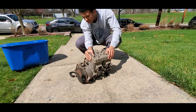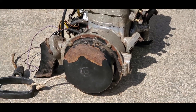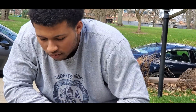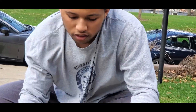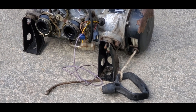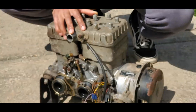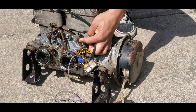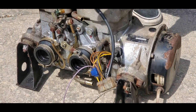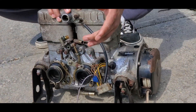The good thing is that it came with the stator and the pull start and everything like that. The cylinders and everything internally is in good condition, and it has good compression. I do need to get a new ignition coil that attaches right here because it didn't come with it, but I already have spark plugs. Next is the pulse pump — this has a place to connect a pulse pump right here, which I have. There are two carburetors, and I already have a fuel pump downstairs. It has one inlet for the pulse pump, one for the fuel tank, and then two outlets for both carburetors.